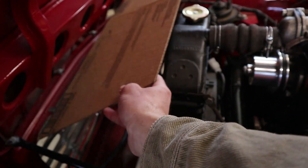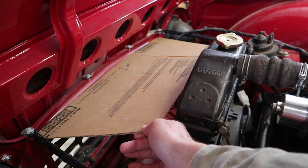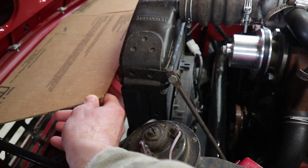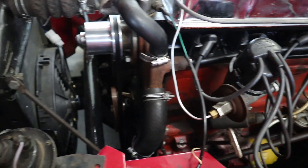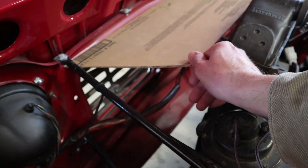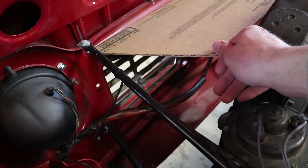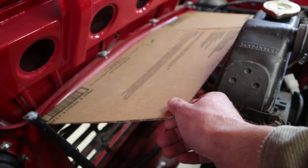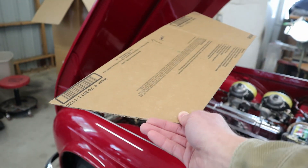That will be one piece. We've left it so it's a little bit wider than the radiator in the front, just like the old one, so that'll let just a little bit of extra air back into the engine but most will be directed at the radiator. Now we just got to make some templates for these two opposite side pieces and then we can use those to get the rough dimensions of our aluminum pieces so we won't end up wasting a bunch of aluminum. That's where we're at — we'll get those sides done and then start cutting metal.